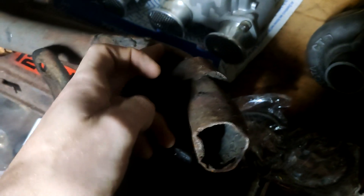I've also done the port matching to the intake manifold as well using this gasket. I have a full gasket kit, all the pistons, piston rings, and rod bearings. I also have a CT09 that I'm going to cut right back and then weld a flange out of a two-inch piece of steel, and then cut and shorten it so it sits lower.